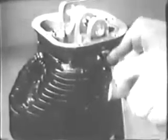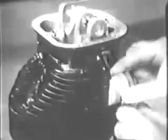The best way to get an old stud out is with the stud remover, turning it slowly so as not to damage the threads in the stud hole. This stud should be discarded and a new one installed. If there's any sign of looseness in the old stud, the new one ought to be the next oversize.